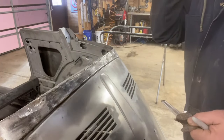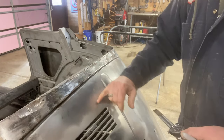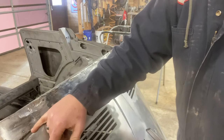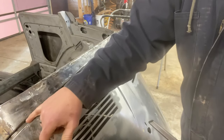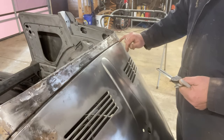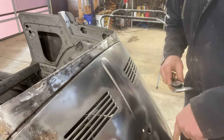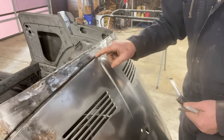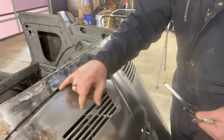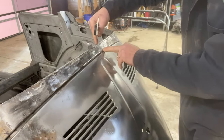Morning, Third Style. It's Saturday morning and we've got an extra day to work on Hendrick today. My hope is to work on the fitment of the deck lid to this — we're calling it kind of a balance panel. Right now we are a little wide through here, a little wide through here, and then this stretch is pretty nice and standard. We get thin through here and then it opens back up. This stretch is pretty nice, then it gets a little wide where our weld is. We're realizing that if I push down with my knee that affects this gap. We would like to get this to about an even quarter-inch gap. So I've taken some measurements with my calipers from there to there.